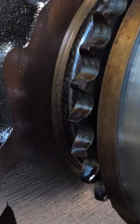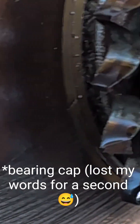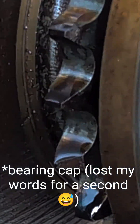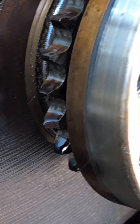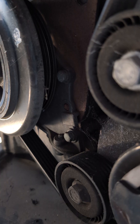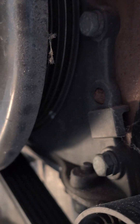You can kind of see that one down there which aligns to a sort of crack or a join in the crankshaft bracket. You can see the ground tooth there versus the ones at the top which are all pointy — there's one that's kind of shaped off. Then on the other side, one final timing point which I've marked with the silver pen. There's a little notch there and a little mark on the block to help you see that it's at top dead center.